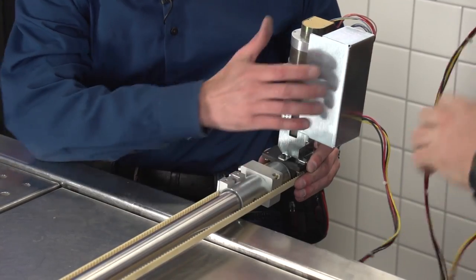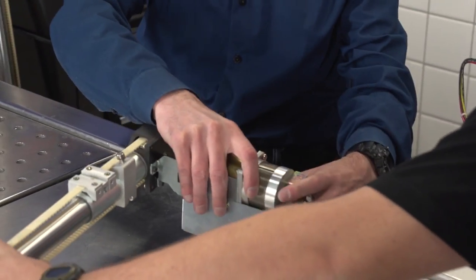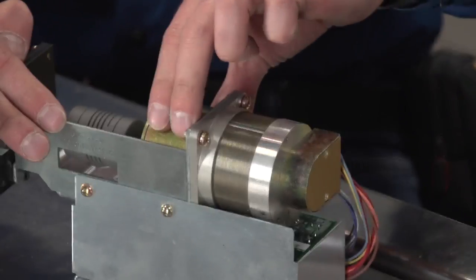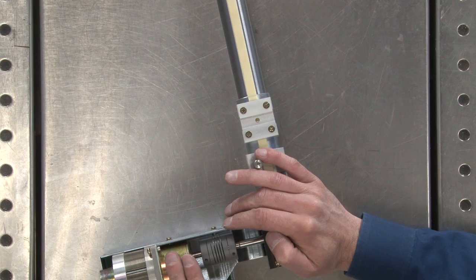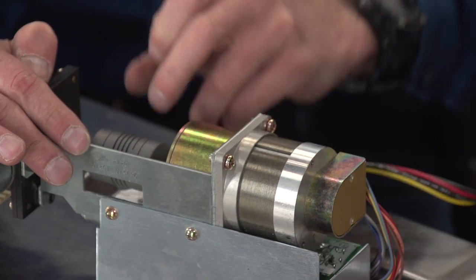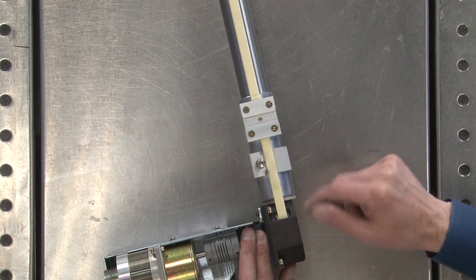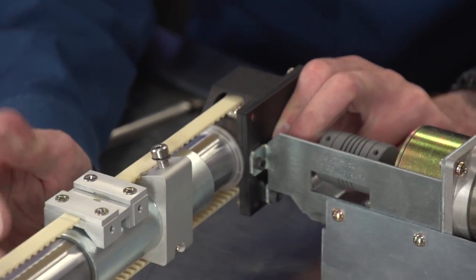And the whole idea here is we have a motor. It's not going anywhere. Here's the motor. Here's the gear drive. You can see the shaft comes out, so there's a little gear reduction drive here. And then there's this shaft. This coupling is just a big spring in the middle, so this handles shaft misalignment and whatnot. Then it goes into here, which is probably just a big toothed gear that grabs this, and then that drives this up and down the shaft.